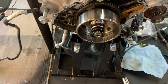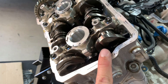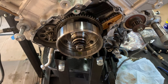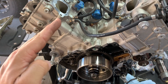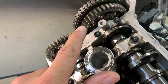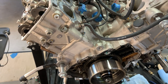You're going to need something to turn over the crank. Remember, this V4 is counter-rotating to reduce gyroscopic effects from the wheels, so keep that in mind when turning it over. You want to make sure things are lined up at TDC — once that piston is exactly at TDC, that's when you can introduce air into the system. I'd still recommend holding your crank with a breaker bar or ratchet, because all that air is going to be pushing down on the piston. If it's not exactly at TDC — even a degree or two off — it'll shove that piston down, rotate the crank, and throw everything out of whack. Make sure you use a degree wheel or know how to find TDC from the cam markings or intake and exhaust valve lobes. The big thing is just keep it at TDC so the crank doesn't rotate.